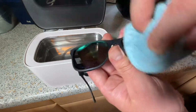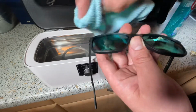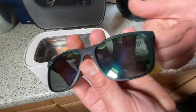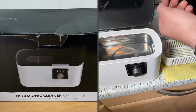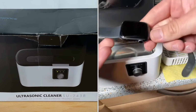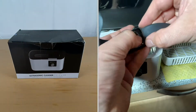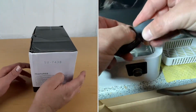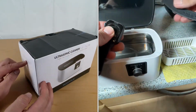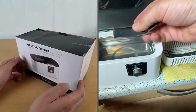Only dip in water, maximum range, okay, you have to look. Then dip a little bit of soap in it. And then take the basket, place the object into the center, get it in position into the tank, switch first, second, or third gear or setup by using the rotation knob, then push the knob, job's done after approximately 8 minutes.